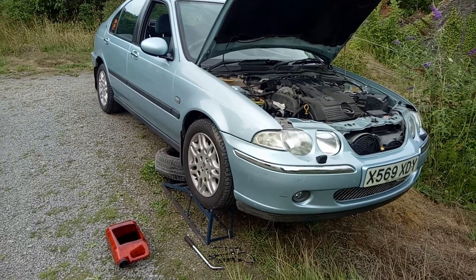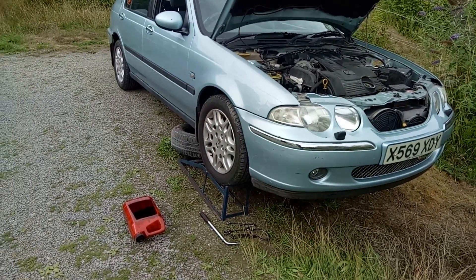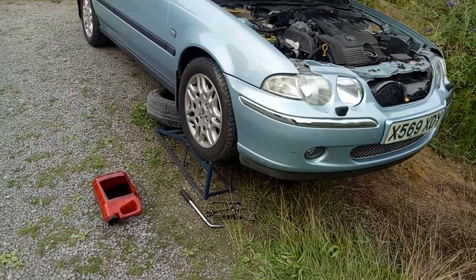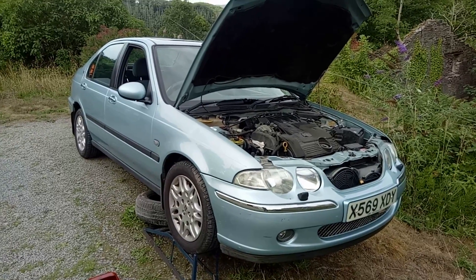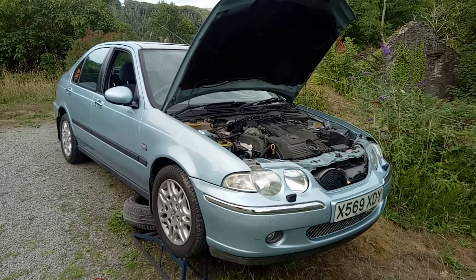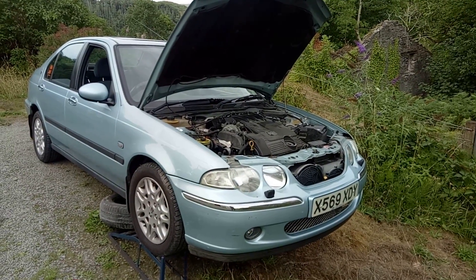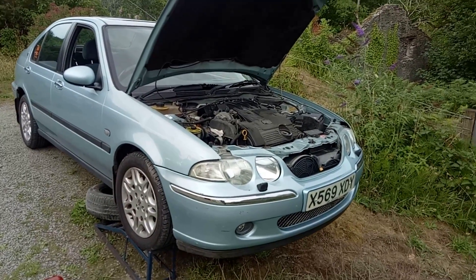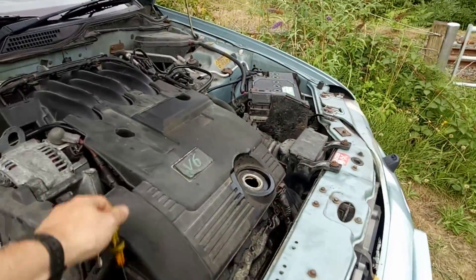I was getting worried because the oil was filling up my catch tank and I thought this shows no sign of slowing down. So I managed to get the plug back in, go and drain that and empty it a second time. And it turns out the oil capacity is 5.6 litres, which is enormous for a 2-litre engine, presumably because it's quite a big 2-litre engine given the quad cams and all that gubbins. So I've poured the 5 litres in that I bought and it still isn't touching the bottom of the dipstick yet, I don't think.